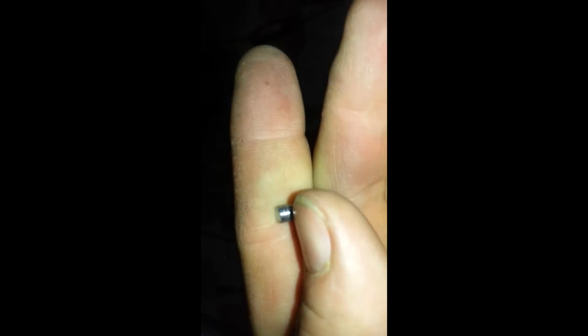So these are the factory screws that come in the cruise control kit. What I had to do was basically buy a smaller one, a little bit shorter in length, and then I put the bike all together, and the throttle assembly was hitting on this brace. So I took my little small hacksaw and got in there, and cut that out, and then I rebundled this to the brace, put some Loctite back on the brace, and hooked it back up.